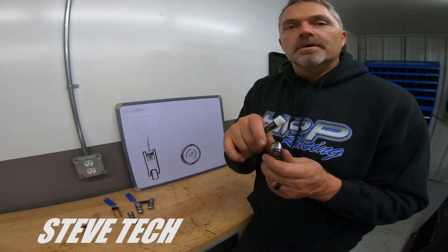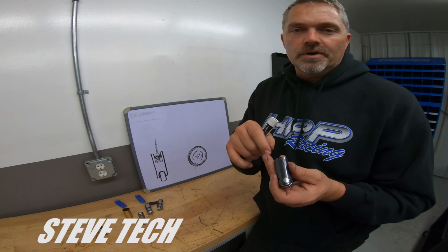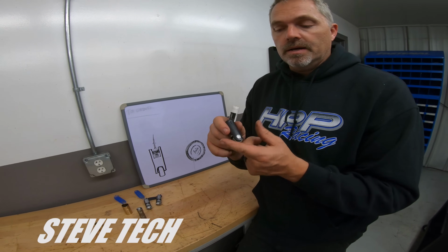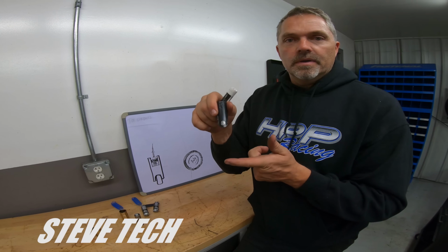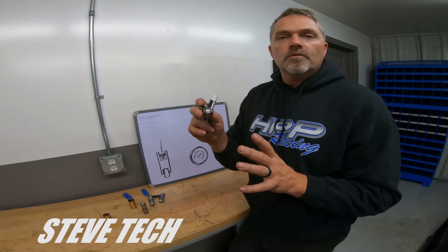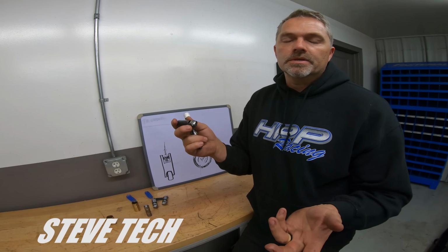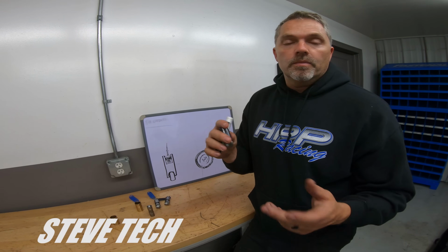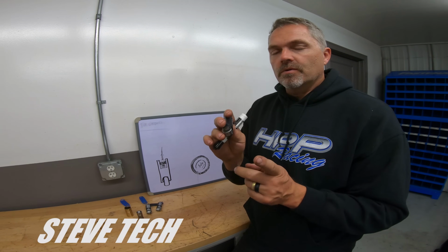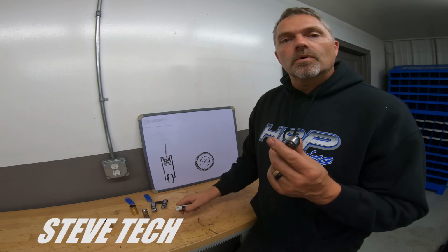With the bigger wheel, we can put a bigger axle in it. It's stronger, more durable. We can put a bigger bearing in it. It's stronger and more durable. Point blank, that's all the lifter cares about. This thing's going up and down, rolling on this wheel. We just want it to live the best that it can. So on all my SMX stuff, we're at a 904 or 937 tie bar style lifter. I'll do them in a Keyway 1062, 1130 if you want to go that big. There's a lot of stuff there. It makes really big wheels, which is better, softer on the camshaft profile. I'll talk about that later. But that is the nuts and bolts of what we're looking at for lifters.